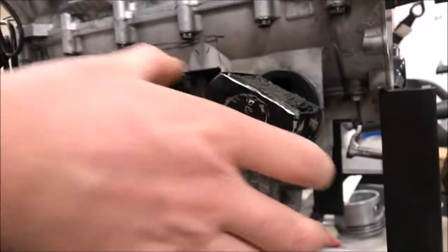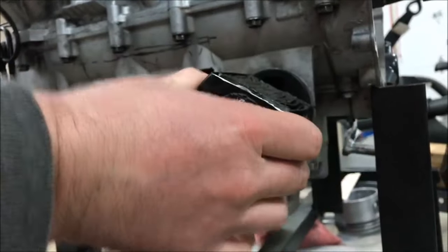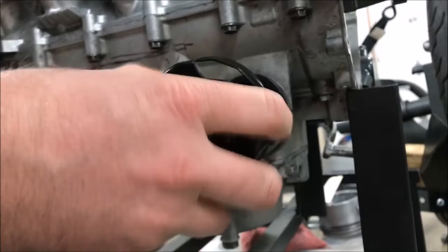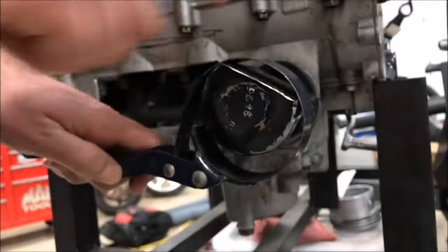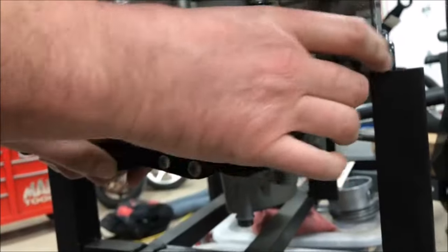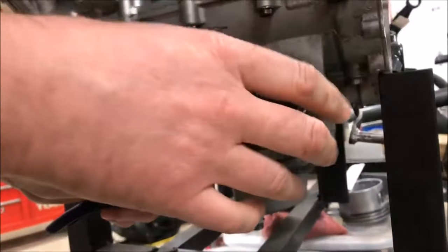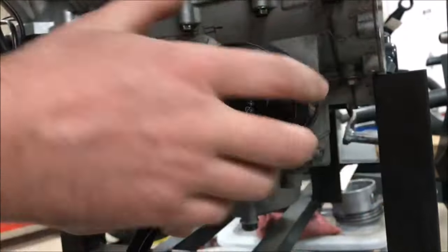Let's look at a cutaway filter. The big tip I want to make here is that this is just a paper filter inside — we've got our relief spring and just this casing. You'd count the flats to figure out what wrench you need. But if you've got a really stuck oil filter and you're putting the wrench all the way out here on a small filter, what are you going to do to that housing? You're going to crush it. And if you put enough pressure on it, you could break the seal from the threads, and now you've got a hot mess.